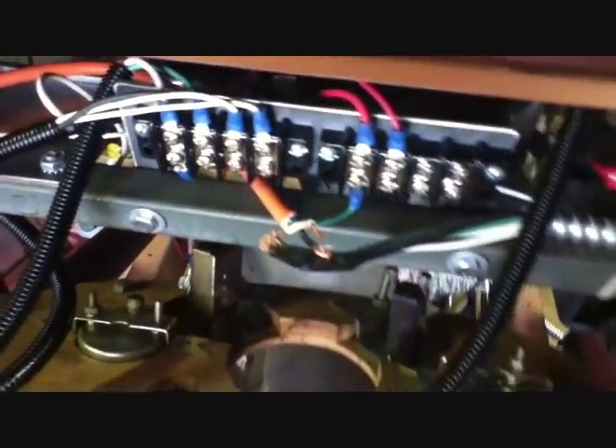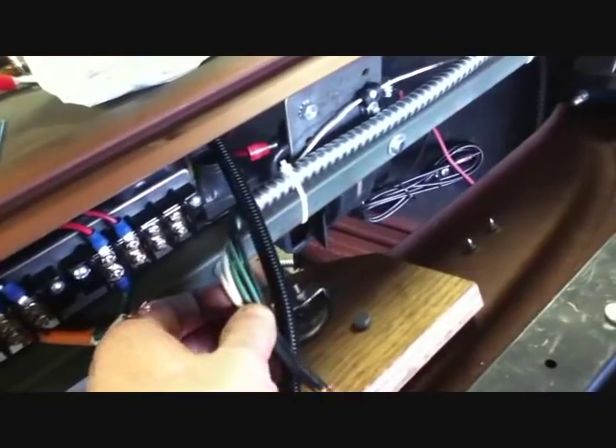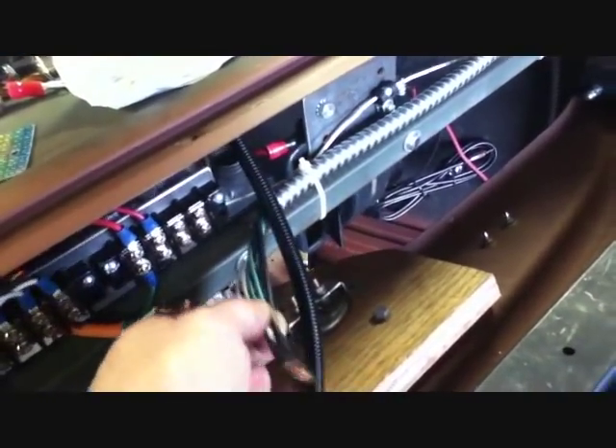This is the column one — it's kind of hanging there because the column's hanging down. The only thing that isn't clean is the white wire: the extension cord for the high beam/low beam. I know my headlights are the black wires. Directionals are the green. And the white — one was nothing and the other one was a horn, I think.